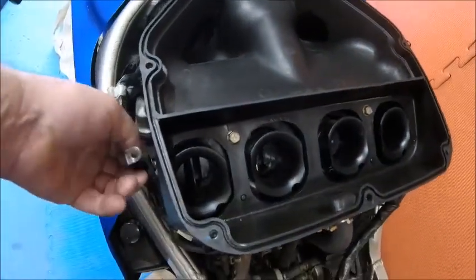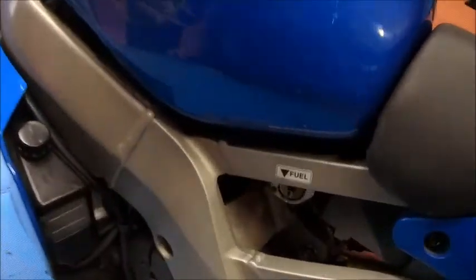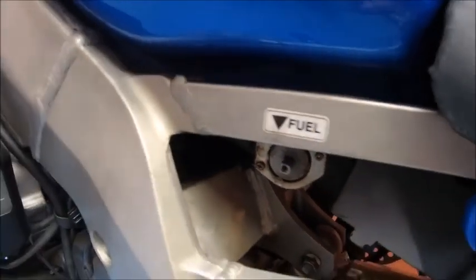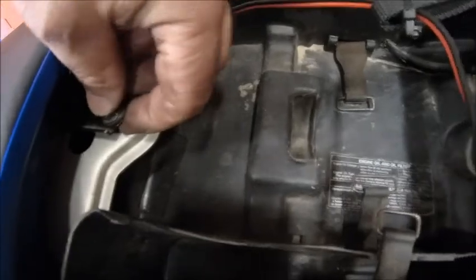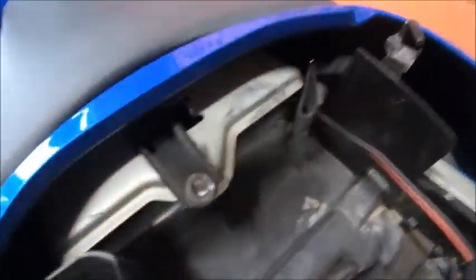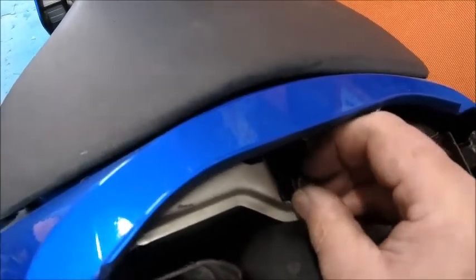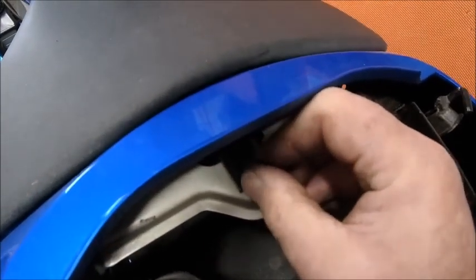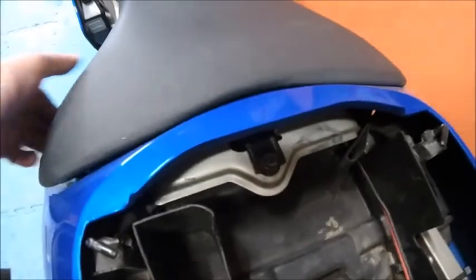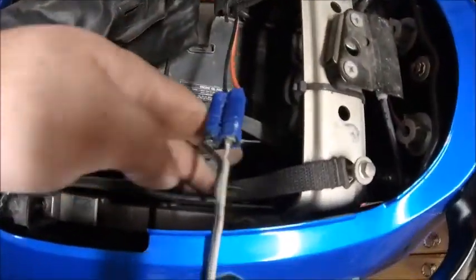The top bit is fairly easy - again don't forget your harness straps, you've got one just there and one on the other side as well. And there you go, tank's back on again. The biggest pain in the backside is obviously getting your pipe back on which is hidden right up there - it's not easy. But literally a two-minute job. Seat's back on, but don't forget your anchor point - that goes in there like that and it slots in. That bit holds the seat at the end, just slots onto the seat onto there. Your retaining 10mm goes in there and then obviously your seat doesn't go anywhere. Let's bolt her up. And one of the last jobs for me is to put back - rocky horse poo - the original toolkit.